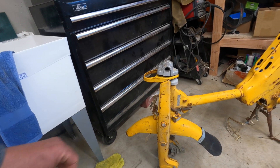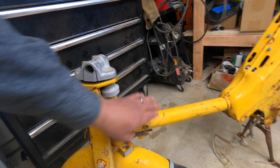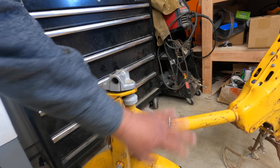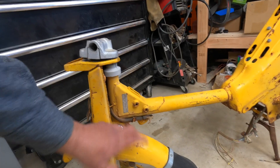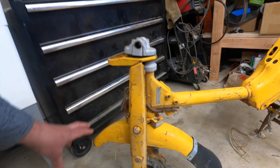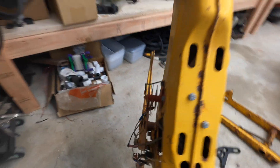Modifications you're going to do to the frame: you can shave a lot of the brackets off of it. This was for the old air box — that can come off. You can cut the locks off if you don't want them. I always remove the fender, as I did on the blue bike. You can cut some other brackets off that you're no longer going to need, but we'll go into all those details.